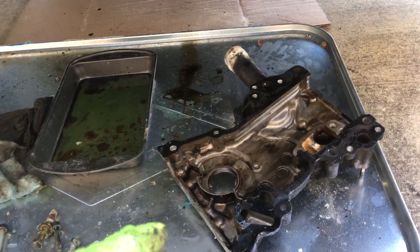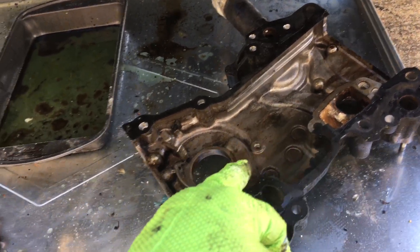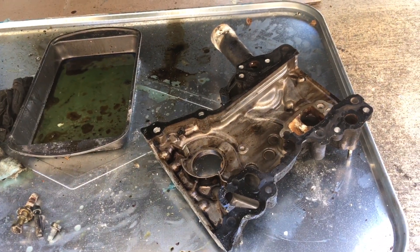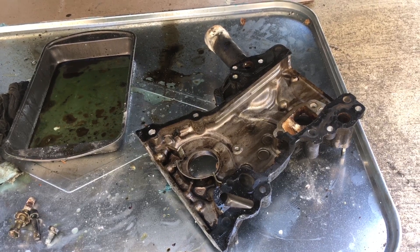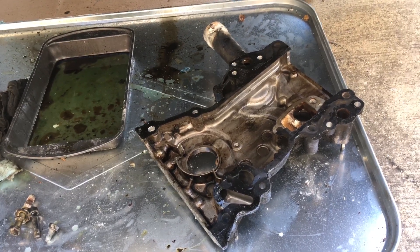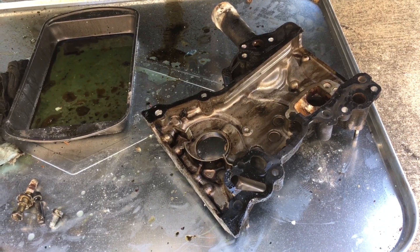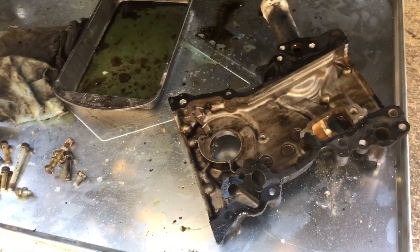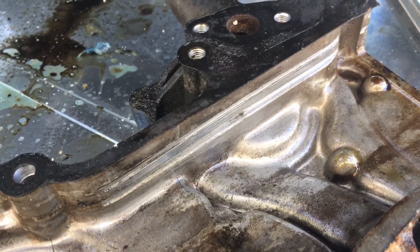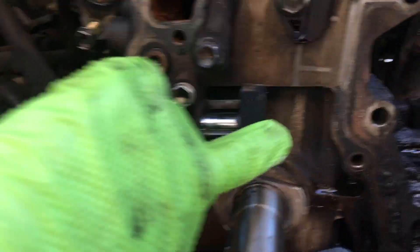That constant little stream of water will manifest as the coolant level going down as you drive, and it will produce frothy milky oil — not always visible on the dipstick, but if you pull the oil cap off the valve cover you'll see a weird milky white substance underneath. That's an indication water is getting into the oiling system. Because the oil system is under higher pressure than the water system, water can only push into the oil system in areas where oil is not under pressure — like near the oil pan — as opposed to pressurized oil passages where the oil would push out into the cooling system instead.